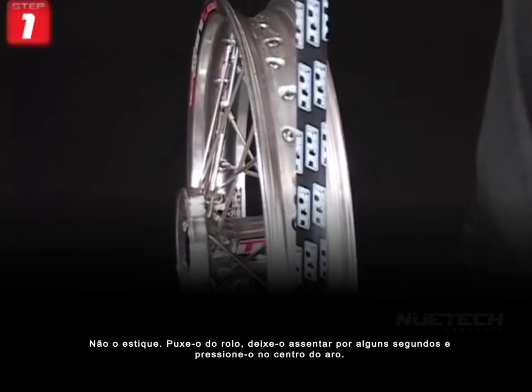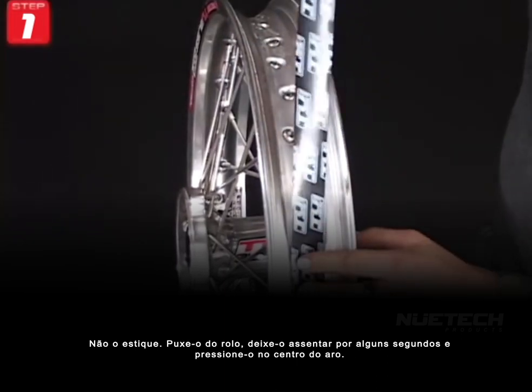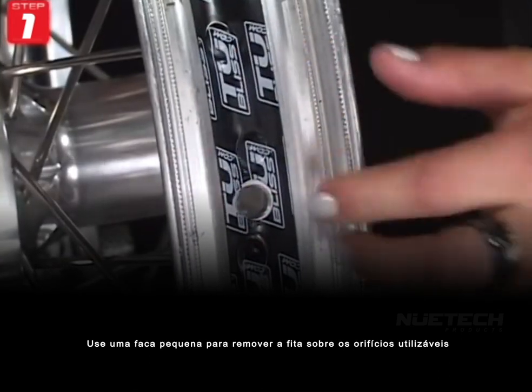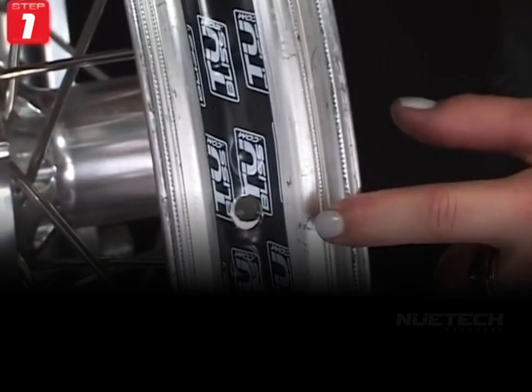Do not stretch it. Pull it off the roll, let it relax for a few seconds, and press it onto the center of the rim. Use a small knife to remove the tape over the usable holes.